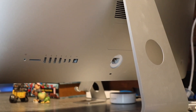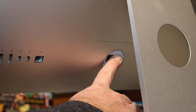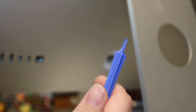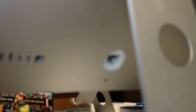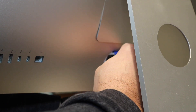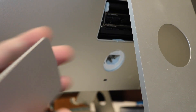This is going to be a little different than some of my repair videos. If you see right back there, that's the door to get into the RAM. There's a little button right here just above it and that should pop it out. I tried doing it with my finger but it's not working, so I'm going to use this — just a little plastic nub — and push it in to get that working. So I'm just going to gently but firmly push this in. Pop it open. That comes right out like that.